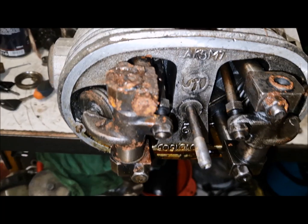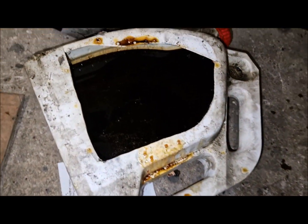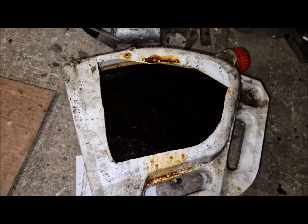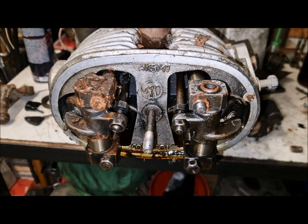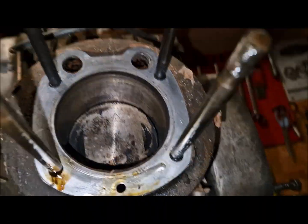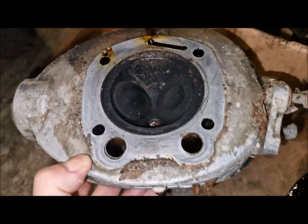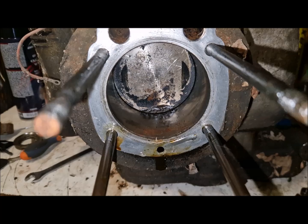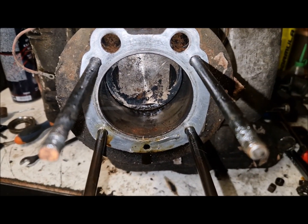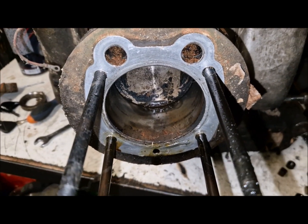As you can see I am opening the engine. You can see some rust — it's not too bad but also it's not a good sign. This is the oil; it is more than two liters because it has water inside. I'll continue and we will see why the engine is locked. This cylinder is not too bad, we have a little rust here. The head cylinder looks just fine, but I was suspecting the piston rings on the cylinder are seized because of rust. On this side it is not the case — I'll have to try on the other side.